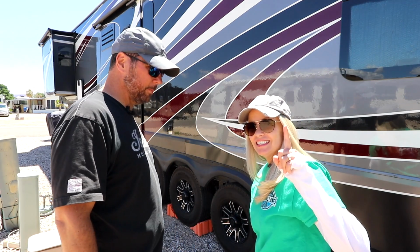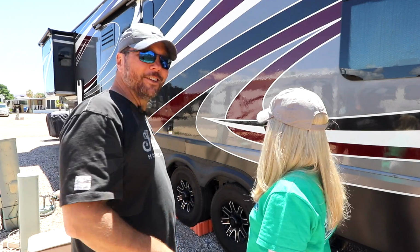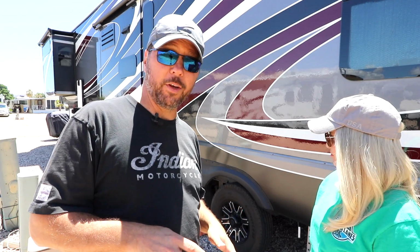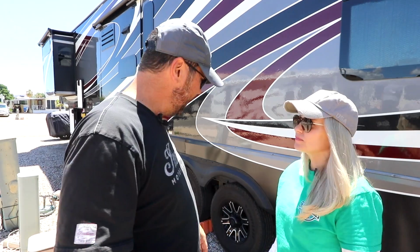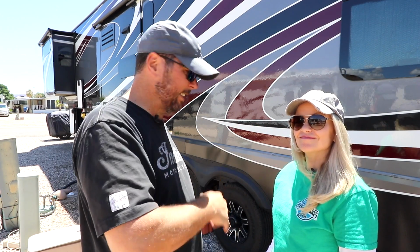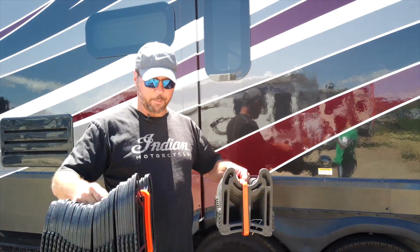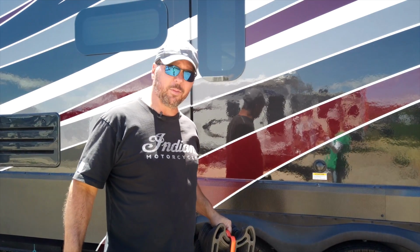First thing, he's got to put on gloves. Nope. Second thing? So first I set up the little guides. You want to try to always make sure that the sewer connection is downhill gravity-wise from your exits. And you want to have some sort of ramping system to kind of get your hose from high to low in a graceful manner. So I put those out first. These are called Sidewinders by Camco. We've got one longer, one shorter, because there's usually a difference in length between the two hoses.